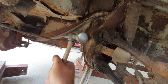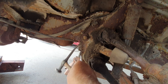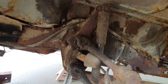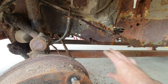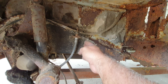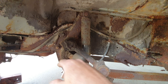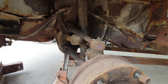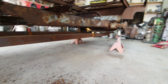Yeah, that looks pretty good underneath. Where the front beam mounts is probably solid. Some people say just change the whole front section — well then I lose my support, I have no support from front to rear if I do that. So it's easier for me to replace from here back than to go forward because I'd have to take the front end off. Our temporary support is welded to the beam — it's the only thing that's solid — and that's kind of holding this thing together right now.